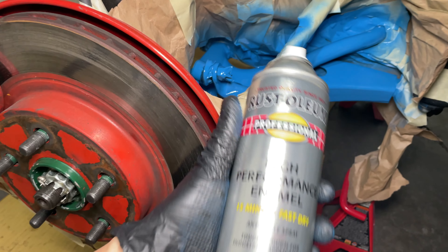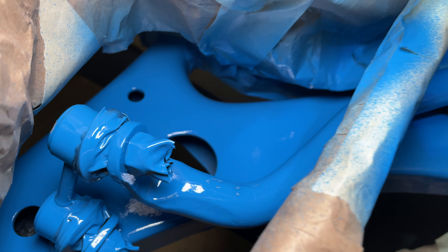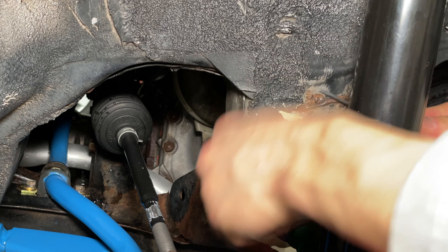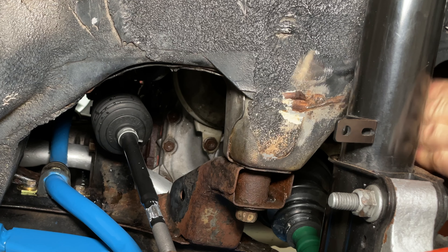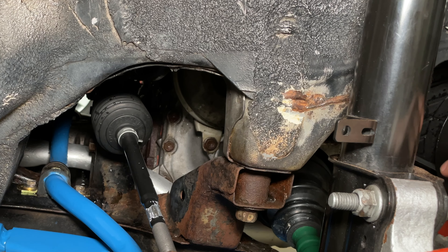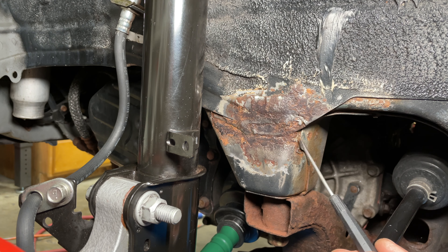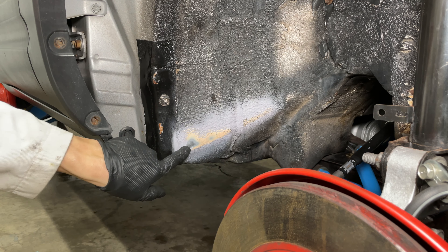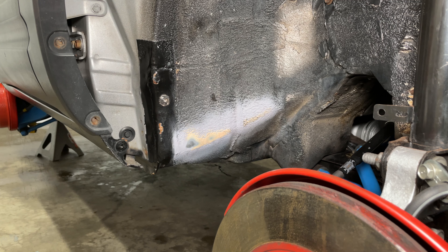While I'm in here, I'll spray paint these inner fender wells and clean them up a little. There's this textured rubberized coating on the inside that's supposed to protect it, but it actually causes rust. Water gets trapped behind the rubberized coating and you get rust — if you leave that alone, that'll continue rusting out your car. The left side of the car was much worse. I've already taken a wire wheel to it and I think I'm just going to spray over it because this is a can of worms I don't want to open just yet. Also, when you install big tires on a RAV4, they'll tend to rub right here, but only on the right side — I'm going to try to adjust this in a little bit.